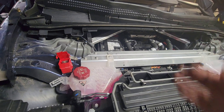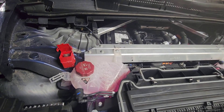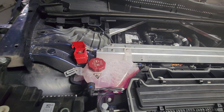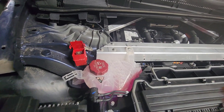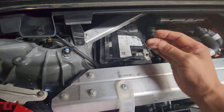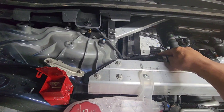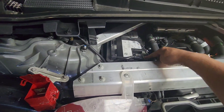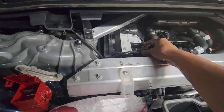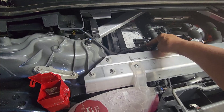The customer got upset and said take the 12V battery out, I'm going to get a new battery. I said no — this is a brand new car, you don't need to buy a new battery, you just got to charge it. So what I did was I disconnected the 10mm bolt and removed the negative terminal. I put my charger straight from the charger to the battery terminal, not using this negative side terminal on the car side.